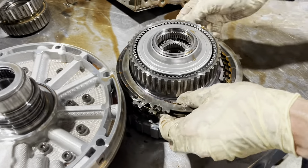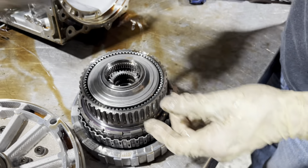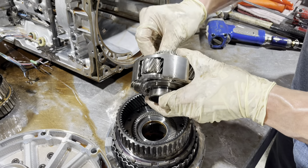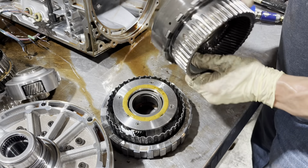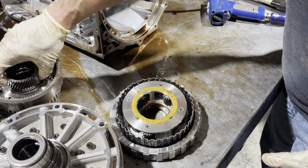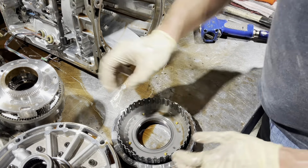We have more burnt clutches here, and this is another clutch pack where we get an extra friction plate added. Sun gear, planetary. We'll go into some more detailed inspection later on - right now I just want to get it apart and get the obvious stuff. Bearing race, another sun gear, another plastic washer. This is a compound planetary as opposed to a regular planetary.